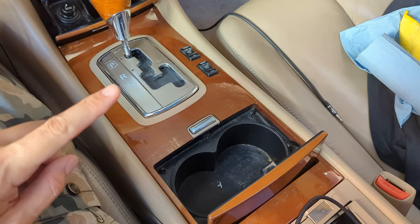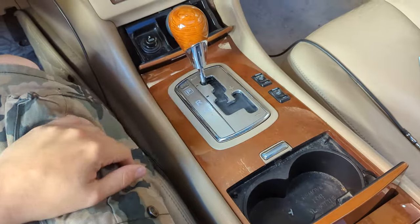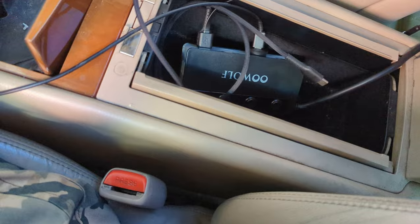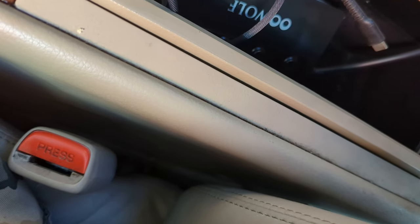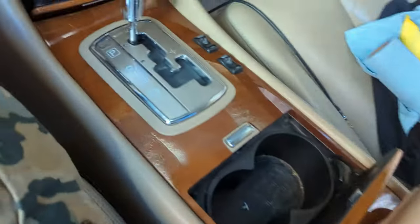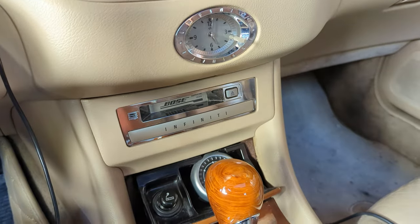You can go back to my Grom audio video — it's super long and includes all my mistakes, but you can skip ahead to get an idea of how to strip this whole thing down since I removed all this stuff in that video. Really all you have to do is get this up, take out a few screws, and there's a hidden screw — one on each side here. You'll need a flat head or a clip remover for a little piece of plastic painted to match the trim. Remove those two screws — it's either a Phillips head or a 10mm — then get in the back here, pulling back and up, and that'll free up all these clips and the whole assembly will pop out.